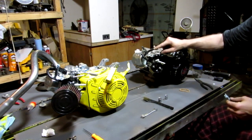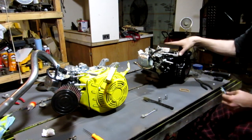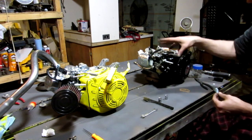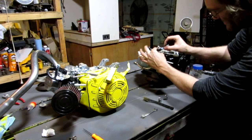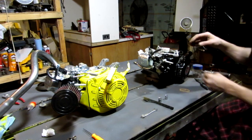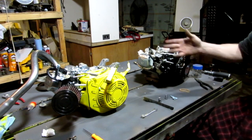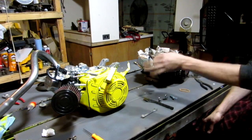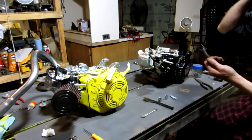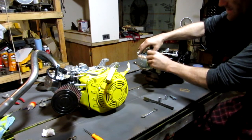That's one reason why you need to get a filter on these things on your overhead valve cover, because it equalizes the pressure as the pistons go up and down inside the engine, plus it helps regulate heat. You want to make sure you hook this up to a filter or something. You don't ever want to leave this open. I've seen people pull this hose out and just leave it like that — that's wrong. You get dirt inside when you're driving around and it messes up your lifters. Leave this hose in and get a filter for it.